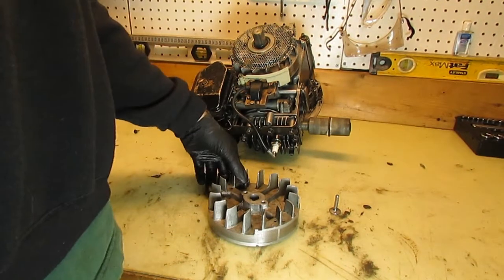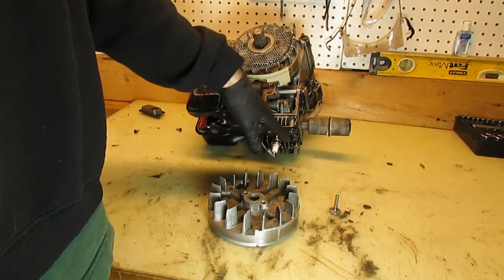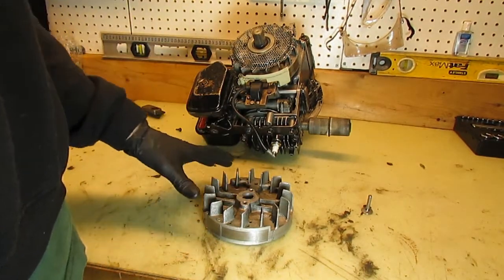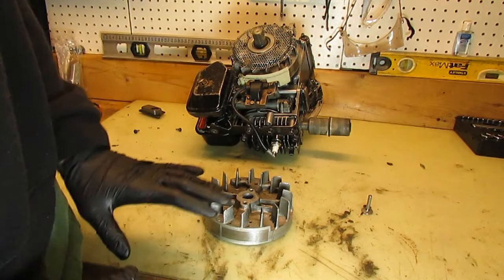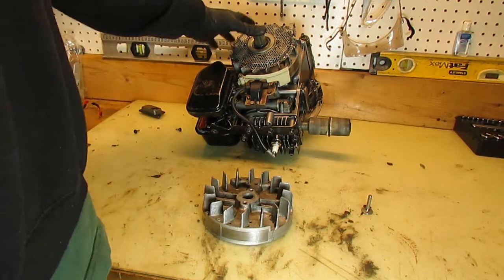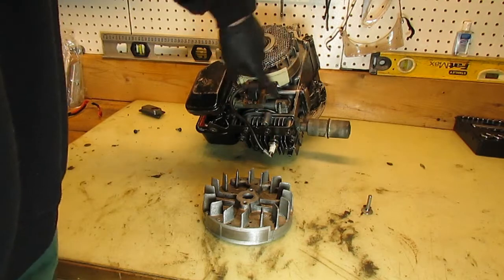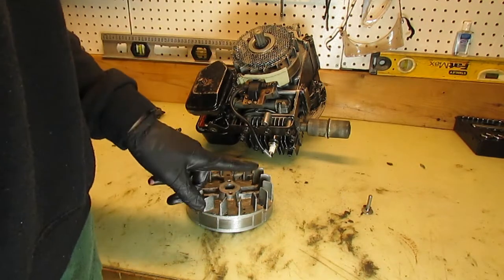The third and final important job of the flywheel is to help with the ignition system. For the power stroke we need a spark, and that spark comes from a spark plug and is created by electricity. On the flywheel, right on the outside, are magnets. When you run a magnet past a coil of wire, it creates electricity — we'll go more in depth on that another time. There's a magnet here; we run it past the coil of wire and it creates electricity. These engines don't have batteries. You might have a battery on a ride-on lawn mower just to get it started, but once the engine's actually running, it creates its own electricity when it needs it. So as the flywheel rotates, it creates a spark using this magnet, and that spark travels along and ignites inside the head. That's the third main job of the flywheel.